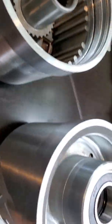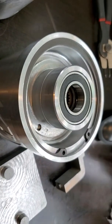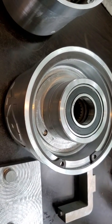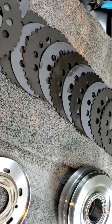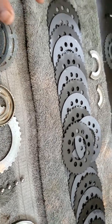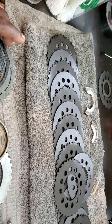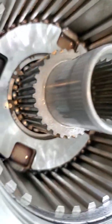That is how your system works — that is how it has always worked, and ultimately your biggest downfall. When the magnet gets hot, it tends to reduce the amount of power that is able to pass through, reducing its electromagnetic signature and reducing the amount of grip on your clutches. With that, you feel a loss of performance. Ultimately, the clutch is spinning freely, partially engaged, burning off the organic friction compound, forcing the oil inside of the coupler to heat up and bake the inside of your coupler, causing a catastrophic failure on the bearing inside.